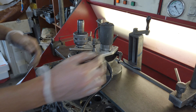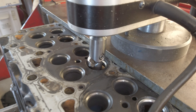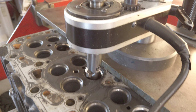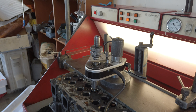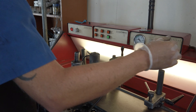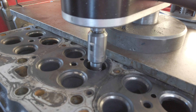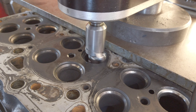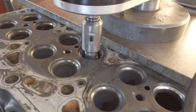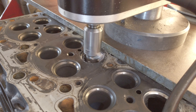It's doing its thing — wait for the light to change, lock it down, drive it. Because it's a wide seat you can probably see the top cut first. There's the top cut, and I can see the throat cut too — so the throat cut and top cut. It gets to the depth and then it'll cut a nice seat in the middle.